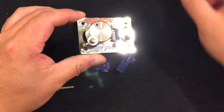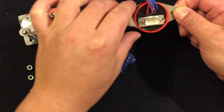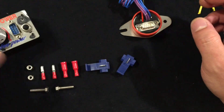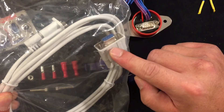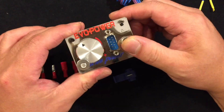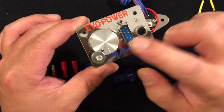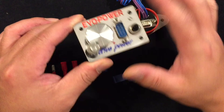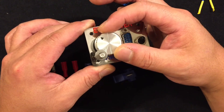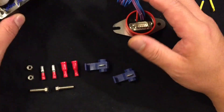This is the controller, and you're wondering why it's separate. This is how it works: the main unit is fully mounted to the bike permanently, but this controller will be disengaged whenever you take it off. You use this cable to attach the controller to the unit. The power switch is on here, and when it's fully anti-clockwise it's fully off - that's factory settings. Once it's all plugged in, turned on, and given live, you can then adjust the fueling in small increments - test, test, test - and if it needs more fuel you increase it, until you get the correct air-fuel ratio.